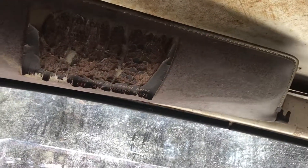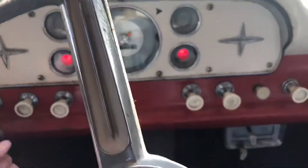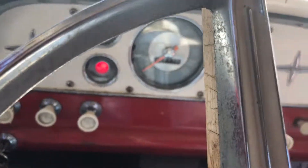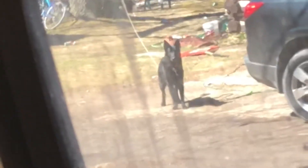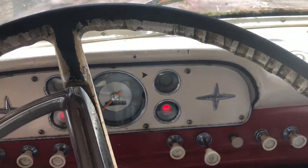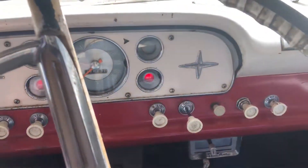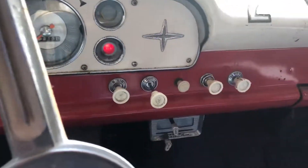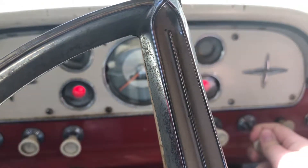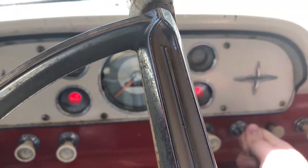She's got a hole in the roof where the light bar used to be. We did rebuild the carb on here — it was full of sand because it was out on an island and they didn't take any care of it. It does have a marine battery in it so it cranks like a motherfucker. Let's try this — pump the living hell out of it. The choke's kind of funky, it doesn't feel like it's there 100%. You gotta be gentle with it — pull it out very slow so it grabs.